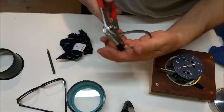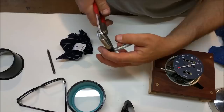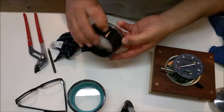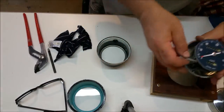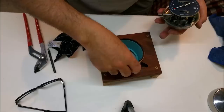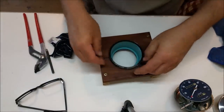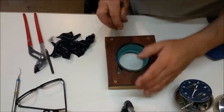These are our multi-grips that have been ground off and I've got a bit of felt around there. I'm just going to go around and work this ring anywhere where I see that it's not quite right. It was not opened up quite enough. Let's try this sucker out. There we go - and we want it to go over that lip, which it does. We can take him out. That's going to go in there against that flat lining. This one's going to go in here. It's got to go in underneath that, underneath this lip. The hole for the tack - so we've got this hole here, it goes through there, and there's the gasket protrusion there.